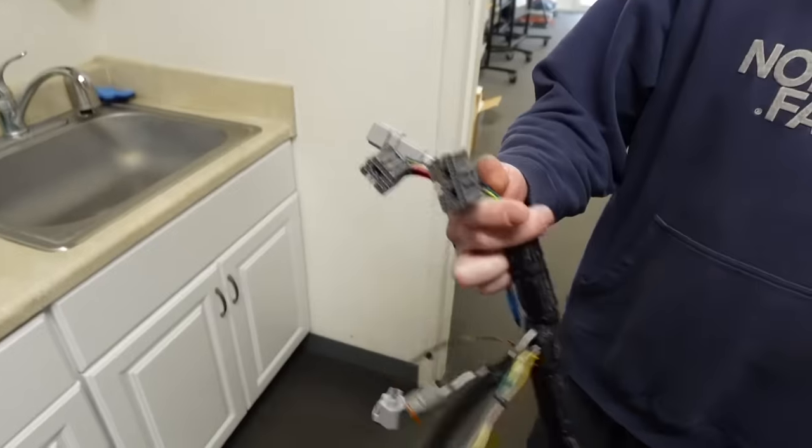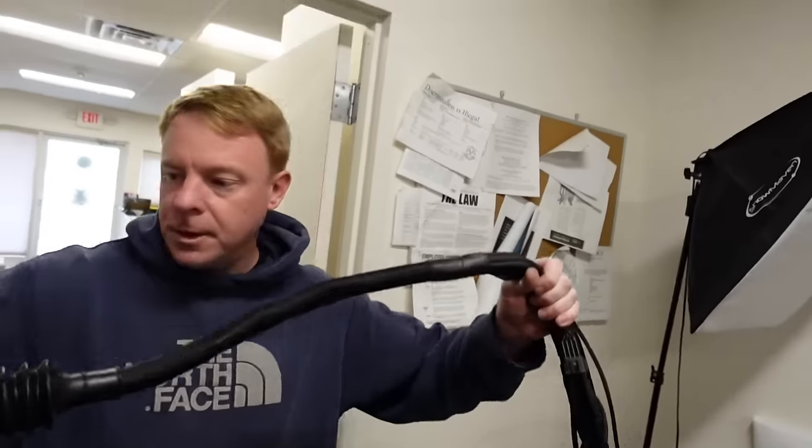A lot of the harnesses that we're going to be doing are for aftermarket ECUs, which require this little box that I showed you last time. Grant did not require that because he's using the Link plugin. What's the main difference? Grant's car is going to have the other two ECU connectors in the chassis. So what our box does is basically bridge the Link from the chassis to our harness. Since you don't have it in there, you're not going to need it because you're going to use your factory ones. So the only thing he's going to have to plug in the car is basically these connections. So you guys made it 100% plug and play. Yep. And everything will work just like a factory one.